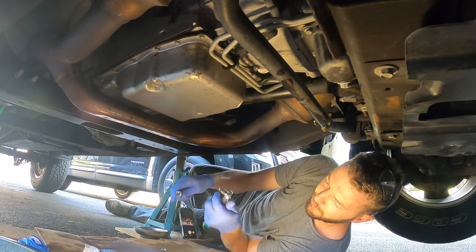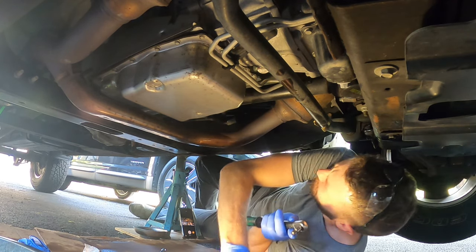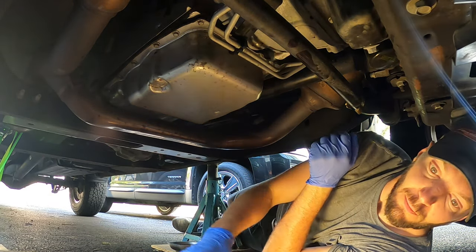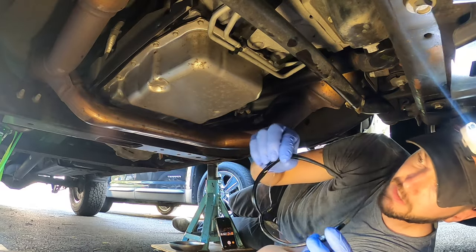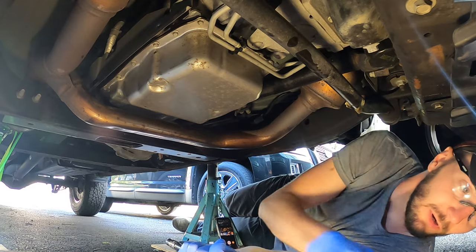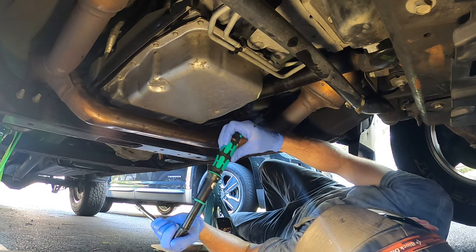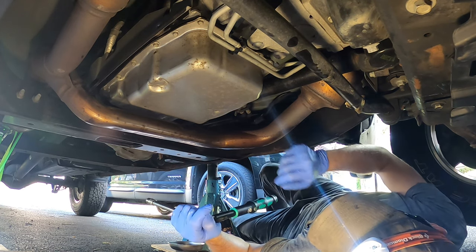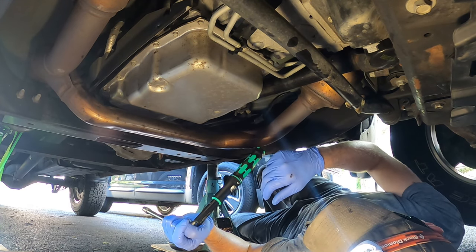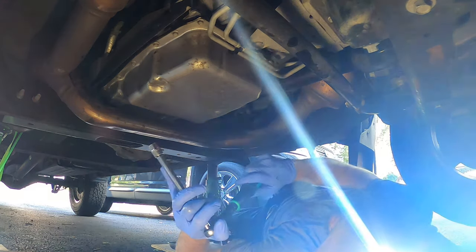So, looked it up, 80 inch pounds, important you remember it's inch. Alright, got a new battery, back to it. So, what I was saying, 80 inch pounds, so we're going to torque these two, nice and slow, just working my way around. I'm going to actually start at 6, go around, and then I'll crank it up to 6.67 foot pounds, because that's what this guy's in, foot pounds. So 6 foot pounds first. So here we go.